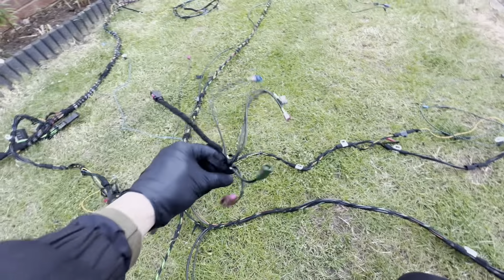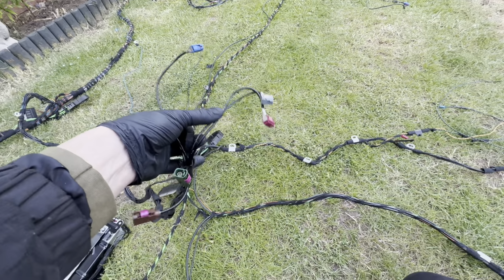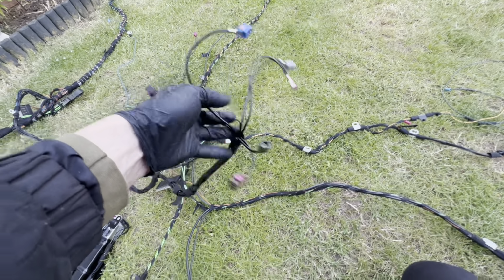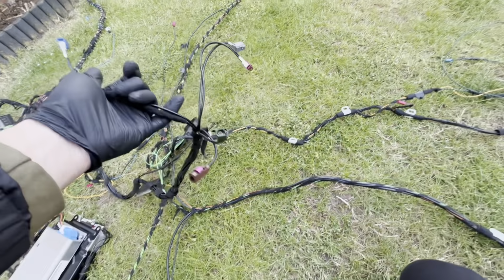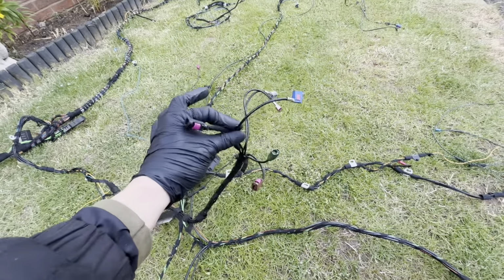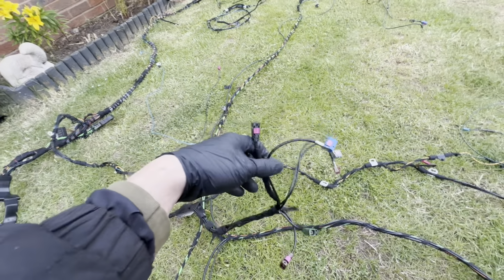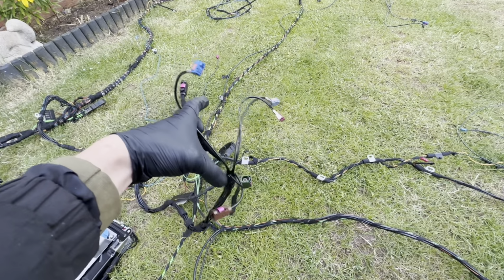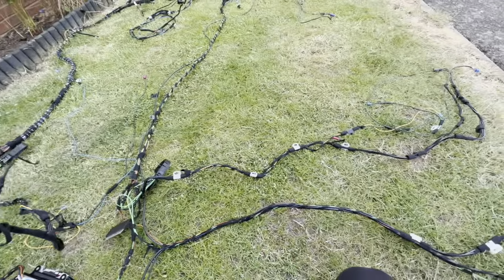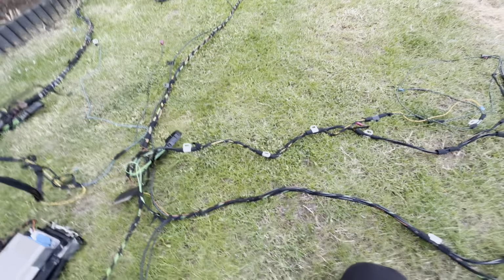Now moving on to the connectors where the shark fin is. So the shark fin connectors is GPS, and those two I believe are for TV signal, and those two in the diversity antenna for TV signal. So my car only has these two, GPS and FM AM, so I think I will keep them. I will add the DAB lead, which I retrofitted recently, along to this loom, and I'll probably remove these two and transfer them onto this loom because they're going back into the car, which is retaining the TV function with the base audio system.